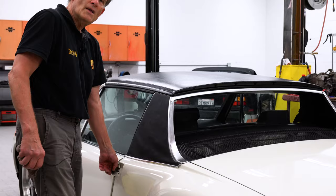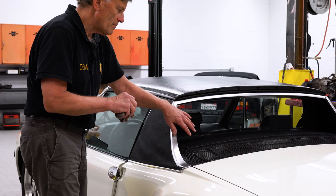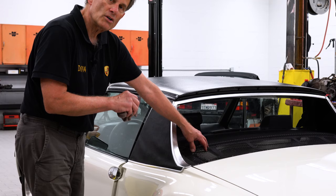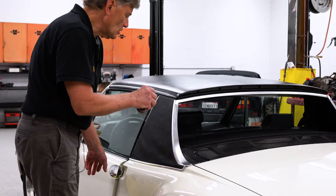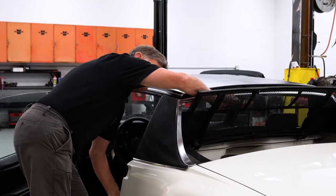It's always critical to hold your hand over the engine lid when you open the car, because it will fly up and hit the rear top and the rear chrome — it's under pressure from the torsion rods. This light German chicken wire engine lid with the original torsion bars that are supposed to pop up the heavier steel will really fly. So I am going to have to hold this one — watch. Notice that's why you always need to hold this engine lid.